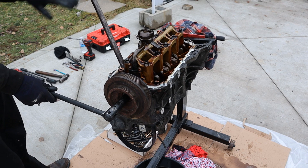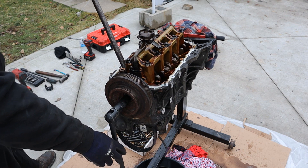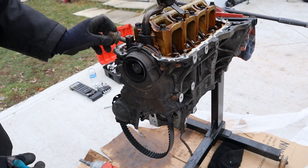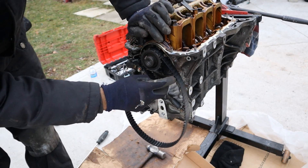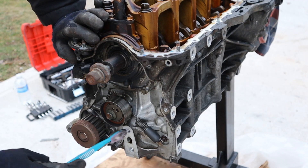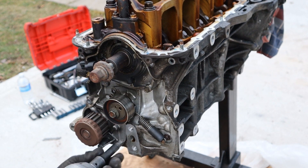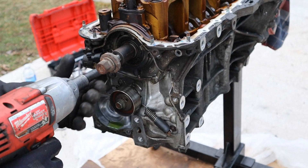I've got something jammed in the connecting rod bearing over here. I'm going to see if I can take off this 19mm crank bolt nut — that was easy. I definitely did the timing belt and didn't tighten that. These things are known to be really, really tight — so much so that Honda built a hex in here so you can get a special tool to hold it. Since the crank bolt is now free and out of the way, I can remove this timing cover. Here you can see the timing belt — the belt has a little Woodruff key inside, and there's the crank gear. It's a very simple spring-loaded cam gear style of tensioner with no hydraulic tensioners. Then over here you have the water pump — you always have to change this when you do a timing belt. Over here we've got the crank position sensor and there's the tensioner.